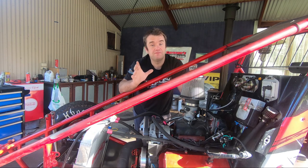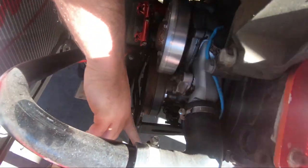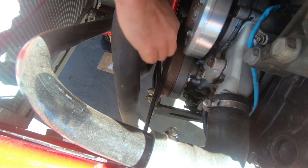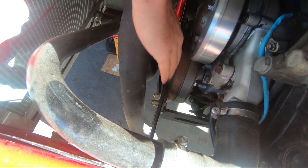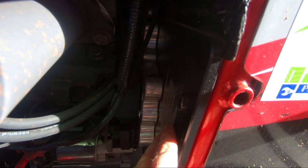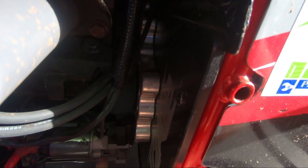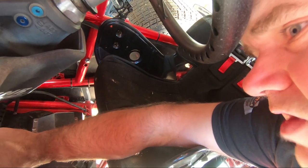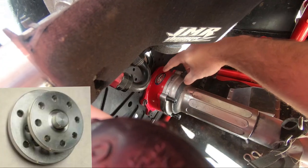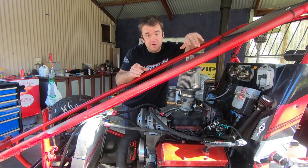Now for question two, what do we do to make them fit and run? As far as bolting it in goes, there's a couple of different options for mounts, but I run a standard aluminium sprint car front engine mount with some adapters — which of these two adapters here — to go to the V6 engine. We also run some alloy blocks to bolt the block up to the standard sprint car engine plate, and it also gives us clearance to run the standard auto flex plate in there and a standard starter motor. We run a small battery in them, so that makes them self-starting. So we don't run a clutch, but in the standard sprint car drive line, we run another adapter that we call a cotton reel, that bolts the standard sprint car uni joint directly to the back of the crankshaft. So to drive them, we just hit the starter button and away they go.